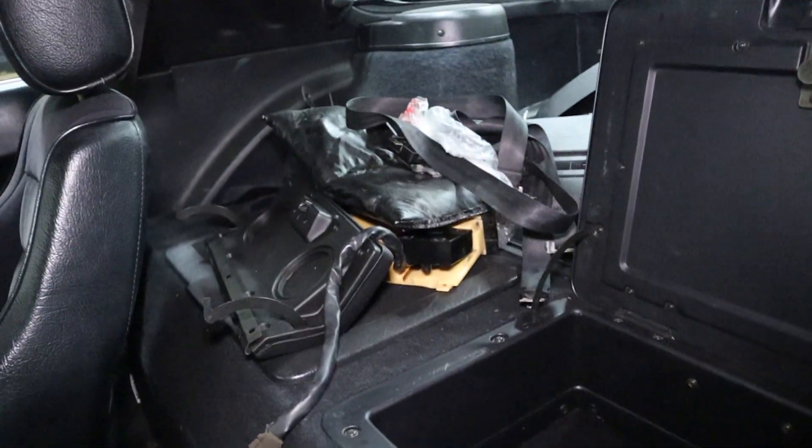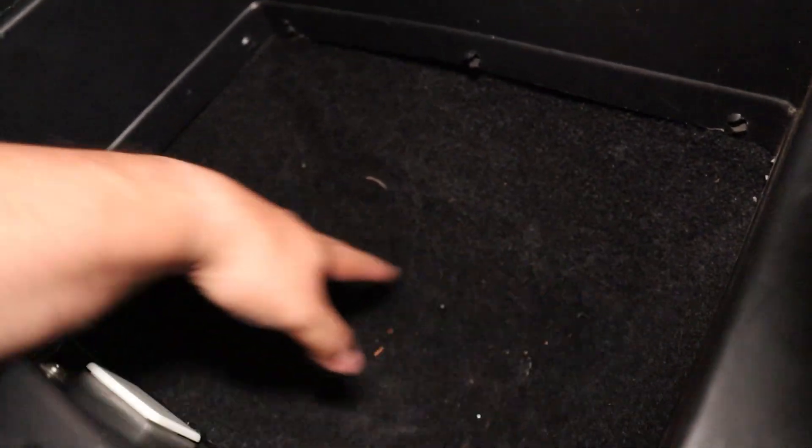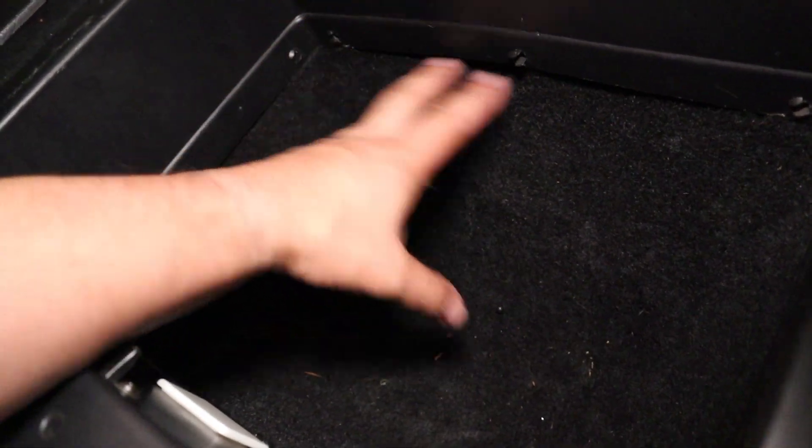If we're not going to put our battery in the engine bay, where are we going to put it? There's one very cool feature on the FC RX-7 that gives us a perfect spot. Right behind the seat we've got two little storage bins and they're actually quite large. I'm going to end up mounting my battery and main fuse box right in here. That'll put the battery in a spot that's not ever going to be visible to anybody other than myself, and it'll still be super easy to service.